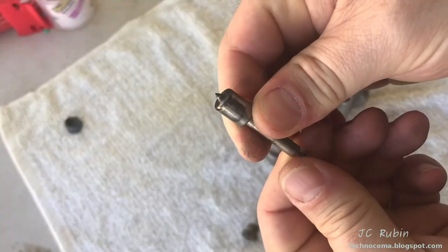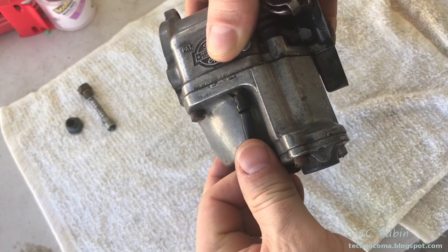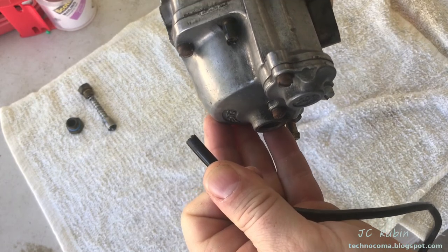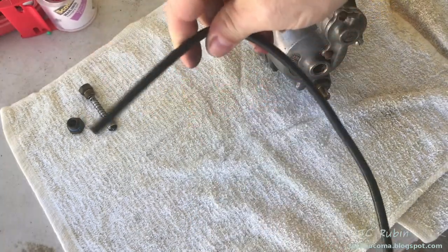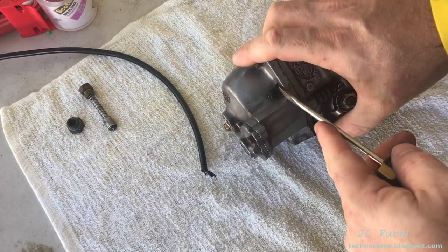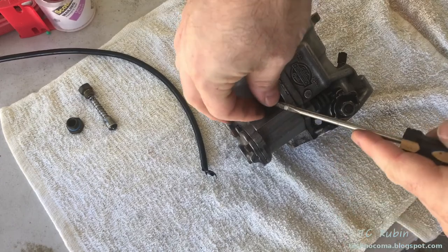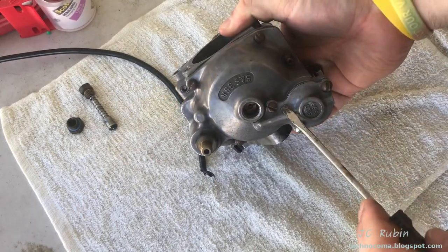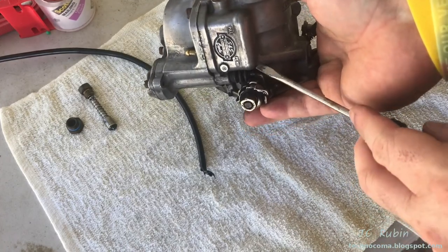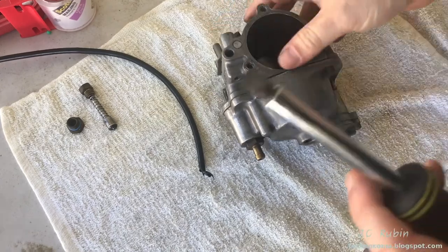Pull that out — this was ready for cleaning. This is the overflow hose that redirects the fuel; this is mostly broken anyway so I'm going to pull this one off. The hose itself is still good so I'm just going to cut the ends and reuse it later. You can see right here is the accelerator pump linkage — this is what pushes down the accelerator pump. We're going to remove this now with the correct screwdriver.